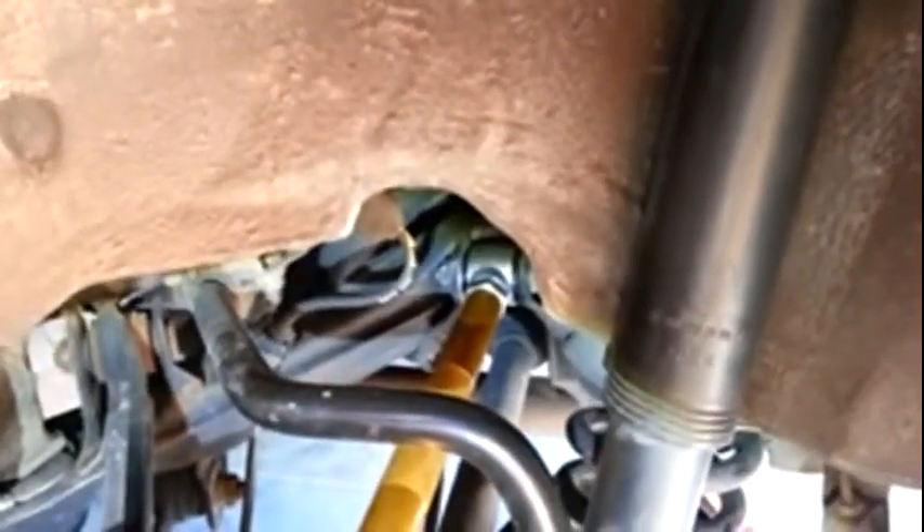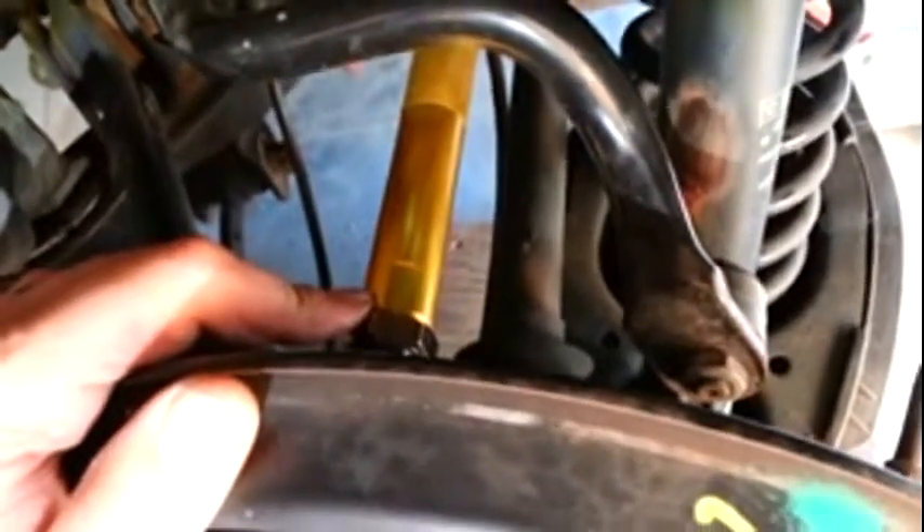Driver side is finished. There you can see the suspension arm with the nut towards the front and the additional washer in place. That's the suspension arm next to the rotor. I want to point out something important: make sure this flat spot on the suspension arm center area is towards your rotor. This is so it can be adjusted with a couple of adjustable wrenches to tighten or loosen the entire suspension arm — which is of course the whole purpose of this project.